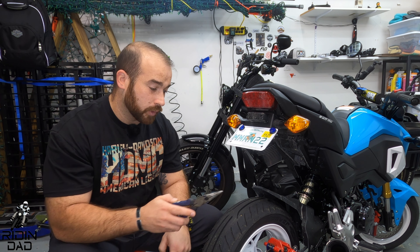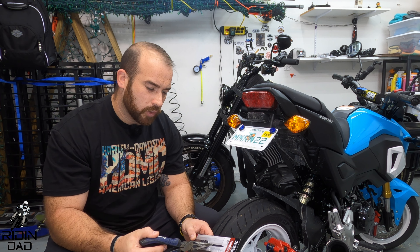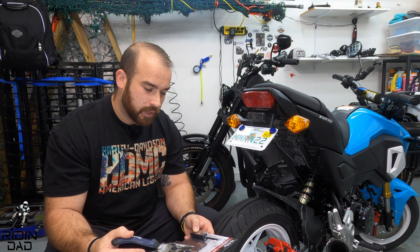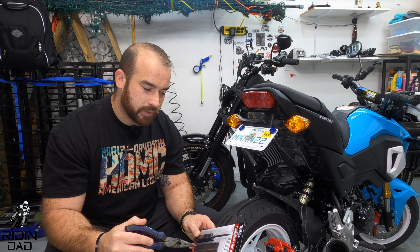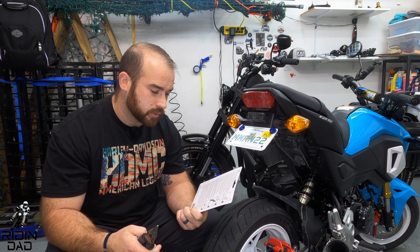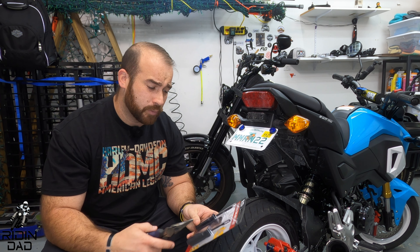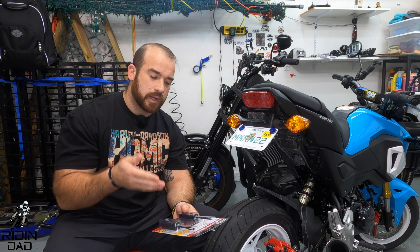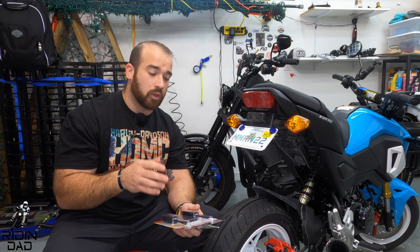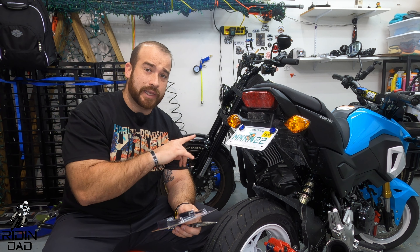I haven't aired down the tire — I'm just going to leave the air pressure as-is, I'm not worried about it. So we're going to remove the nail, hopefully it's not crazy underneath. Then we're going to ream out the existing hole, make sure it's nice and clean, and then stick the spaghetti noodle in there. I'll bring you closer — the instructions are right here. This kit was about five bucks at a hardware store and came with a lot of plugs.